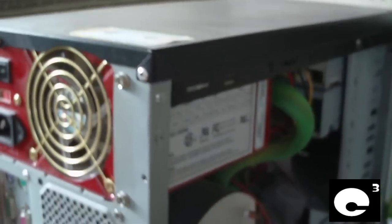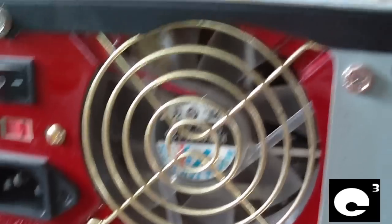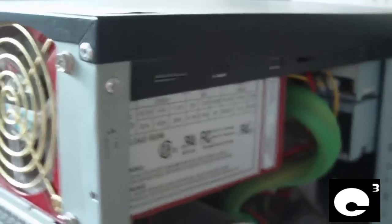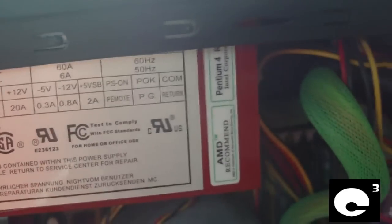I think it's an issue with the power supply. When it's on, it works fine. I think there's probably a couple bad capacitors inside this power supply that need to be switched out. The power supply has been in service for 2 years. It's a Dynapower USA Cherry Red 500 watt power supply that sells for like 20 bucks on Newegg. Decent for what it is, but the capacitor brand isn't the best. That is used inside this thing is JEE, some generic brand, unlike Rubycon or Sanyo or Panasonic.